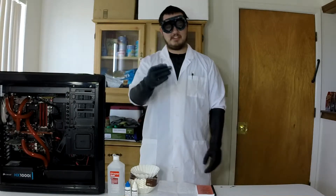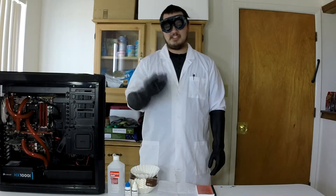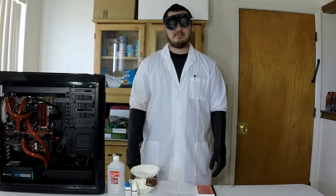So in this video we're going to demonstrate how to properly TIM your processor, because I've seen lots of videos online and it makes me uneasy to watch them. I want to do some science — or whatever the hell this is, it's a YouTube video I guess. There are plenty of different ways to do TIM application. People like to do the dot, a grain of rice, X, smiley face. You could probably put vulgar words on there if you wanted. But really it all matters about even application and not overdoing it. I'm just going to do these experiments with the simple dot on the center of the processor — pea-size, just normal run-of-the-mill application. One of the most popular methods is the spread — spread that TIM nice and thinly on your processor. I like to call it the mayo, because it reminds me of sandwiches. And my god, a good sandwich is awesome.